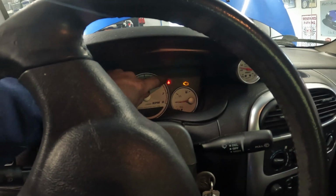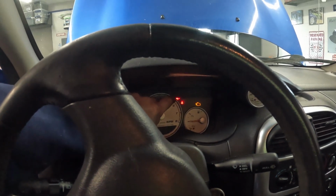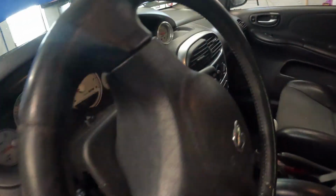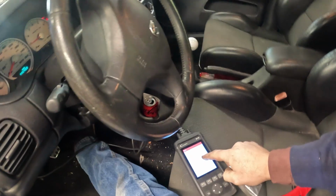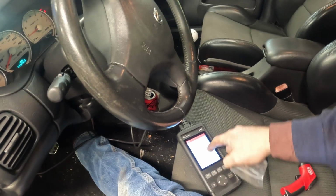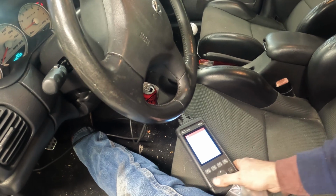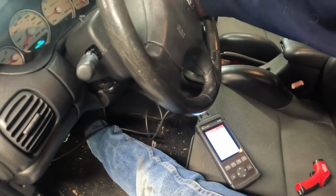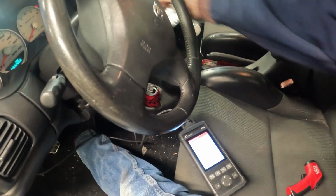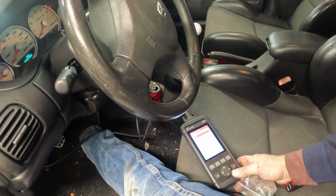We still have an oil light, which I believe is the commonly failing oil pressure light thinger. The check engine light was on. The red solenoid plug was undone, so I was waiting till I brought this up to temp to clear it, but everything else is showing perfectly fine. So shut it off, turn this on, turn off our fan, erase codes.